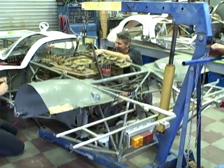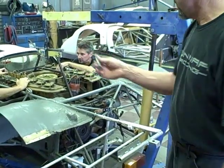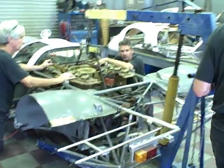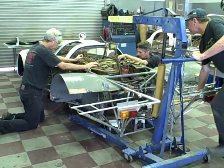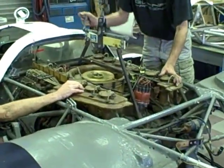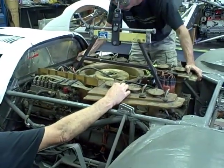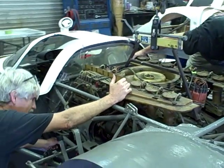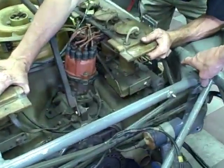We're ready to start cranking this thing up now. There's a long titanium bolt — that's what holds the front of the engine up, and there are two bolts that hold the back up. Three bolts hold this whole engine in. Now delicately, delicately, we all play a role here coming up. We'll discover how much stuff we forgot to disconnect. It looks all right right now — inch by inch. You can see there's not much room. Bring the camera in here — you can see the valve cover where it hits the chassis.